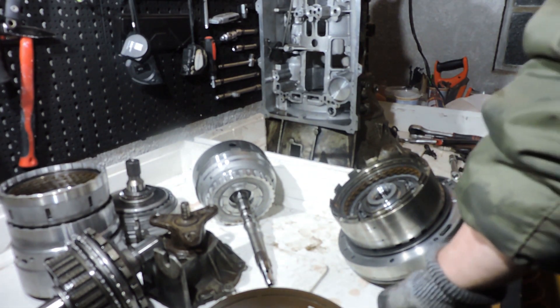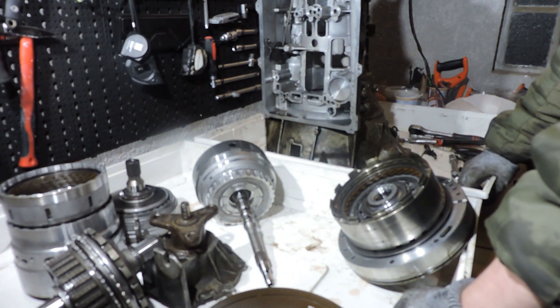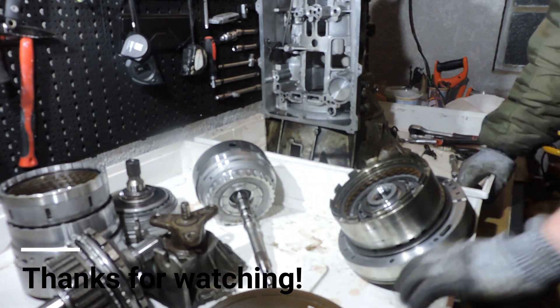Removing the snap ring we're able to remove the stack of friction and steels. Taking this clutch plate out — remember about 180,000 kilometers of highway driving with frequent oil changes — you can still see the numbering of the clutch plates that they put in at the factory when they cut them on the friction material. Even with oil on it, I still feel good friction material. So I'm happy to see that the rebuild I did so many years ago actually turned out great. Everything is still in pretty good shape. This is not just a silly reverse clutch — this is actually a forward clutch — and I see a very clean piston, a very clean inside of the drum, clean steels, and friction with good material. I probably don't even have to renew these frictions, but since the friction kit for the 5HP18 is not that expensive, if I decide to put this transmission back together I'm definitely going to put in new frictions. With the final plate back and the snap ring reinstalled, I'll see you in a few days for part two — inspection of all the parts more thoroughly. If you've got any questions on this transmission, post in the comments or send me a message over YouTube.